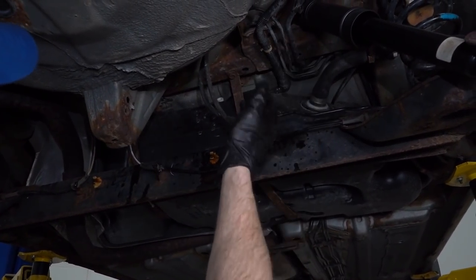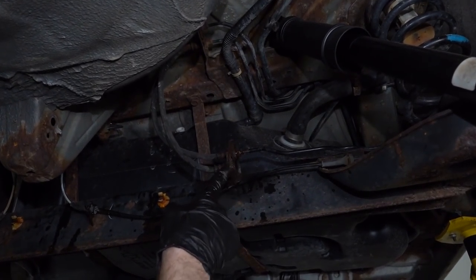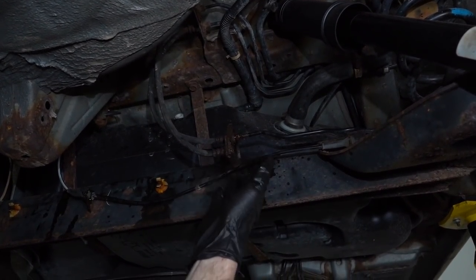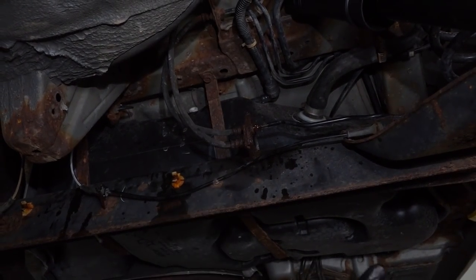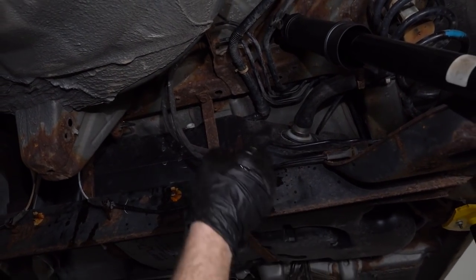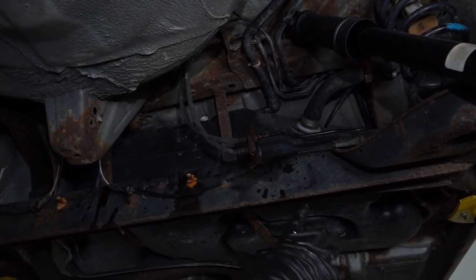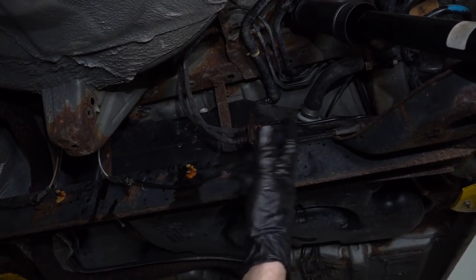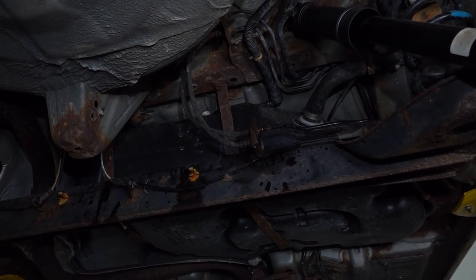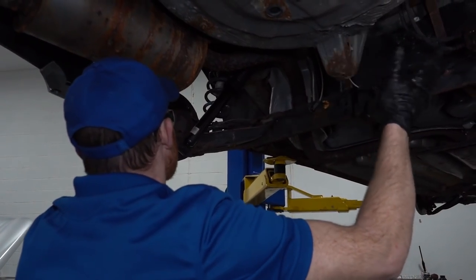Generally, like I said, if you press down on that brake pedal like what we did, it's going to cause a vacuum inside the system. And as you can tell, this isn't leaking. I'm not worried about it. But the main reason why I'm stressing about this is because you don't want to drain all the brake fluid dry from inside your braking system. You could find that you have an issue trying to bleed it out. Getting all the air out of your ABS unit can potentially be a little bit difficult, and it's going to take some time overall. So with all that said, now we can continue on to starting to make our new line.